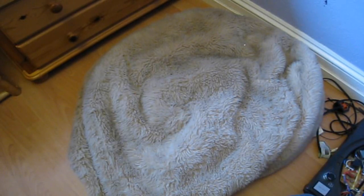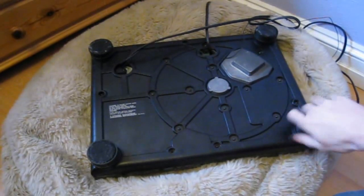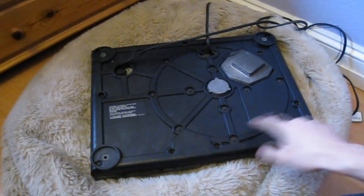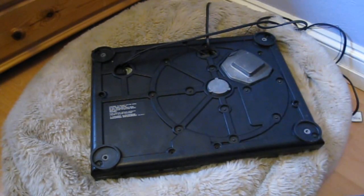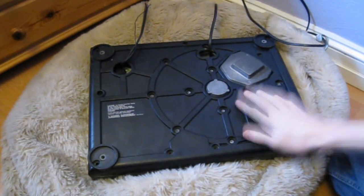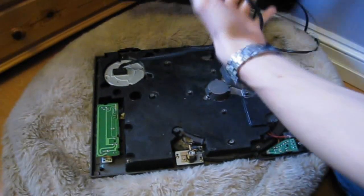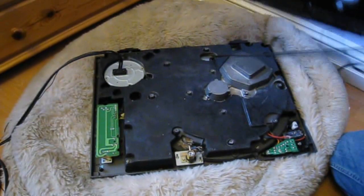Now you've unplugged those, it's time to flip the turntable upside down onto the bean bag — or your sofa or bed, something soft that it's not going to get damaged on. Once you've done that, you need to take the bottom off. First thing is to unscrew all of the feet. Once you've taken the feet off, remove all the screws from the bottom — there's a link in the description to another video with more detail on that. Then you can peel this rubber piece off the bottom, which sometimes is a bit difficult but most of the time comes off fairly easily. Pull the audio cables through the hole in the rubber piece and keep those out of the way, but the power plug you can't get through that hole.